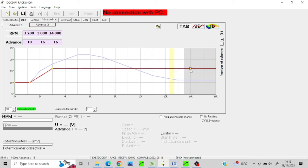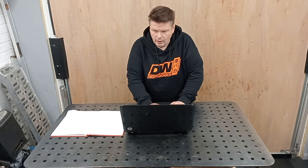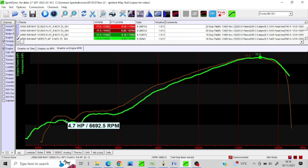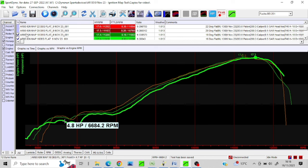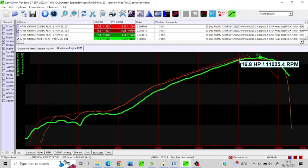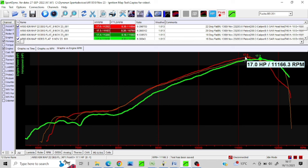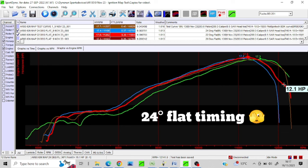There are no complications — I'm just trying to use that flat line to figure out where the power's best, join all the powers together with the best ignition timing. 22 gave me quite good peak power — I actually picked up quite a bit on the upper curve. And finally, fingers crossed, I went for 24, which is picking up at the bottom.